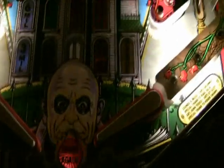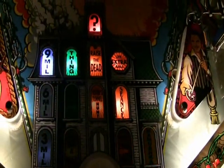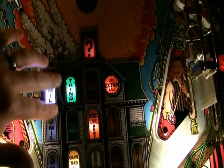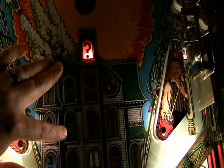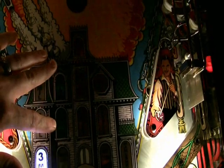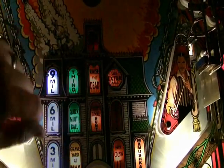I'm in the middle of changing these lights out for LEDs. One thing I wanted to point out is the difference between using all white LEDs versus matching the insert colors. With these two green ones right here, the top one I used a green LED and the bottom one I used a white LED. The top one is a lot more of a deep, rich green, while the bottom one still looks nice and is actually a little bit brighter than the incandescent bulb, but it's more washed out and not quite as deep a color.